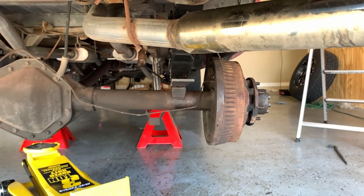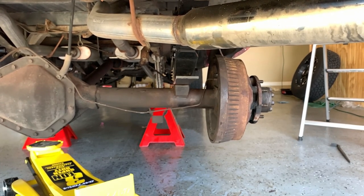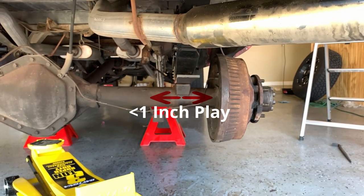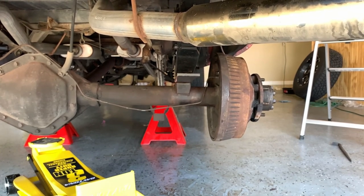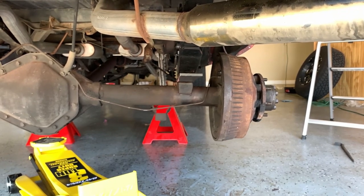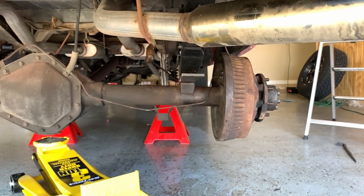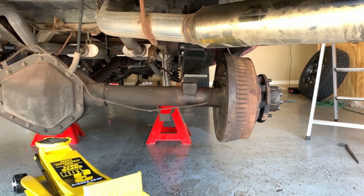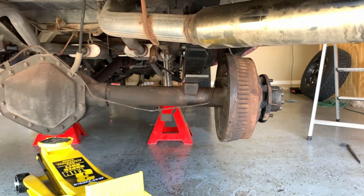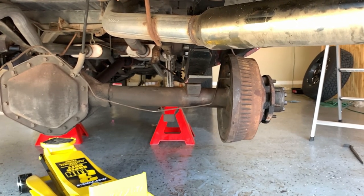A lot of times you may find that after mounting to the forward and rear mounting points for the leaf spring it doesn't quite line up exactly perfect with the mounting block on the rear axle. Don't freak out if that happens — it's very common in older vehicles. If it's off more than a quarter to three-quarters of an inch you've got a serious problem, but if it's just slightly off that's one of the reasons why we don't torque everything down yet. It's natural for some of these older vehicles — especially if they've been in accidents — to not be 100% straight. Make sure that you have the vehicle checked for alignment, not only in the front wheels but also ensure that the alignment in the back wheels is safe for highway driving.